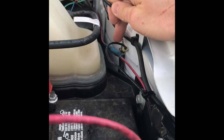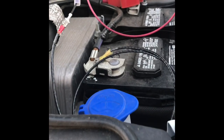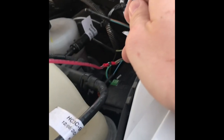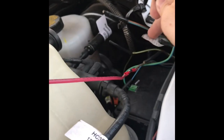Your black wire, which is your ground, you're going to hook that to your neutral — or the ground — on your battery. For my other one, for my Raptor lights, I hooked the ground right here. You can see there's just a nut right there that I backed off and just put the ground on that. That's probably where I'd do it this time too, but just for this quick video I put it on the ground right here on the battery. So any kind of accessory you're going to wire up is going to have a hot and a ground. Your hot goes to your relay — the relay you want to use, we picked number 4. Just follow the directions on the sheet for whatever one you pick. Hot leg goes to the relay, ground goes to your battery or a ground somewhere on the truck.